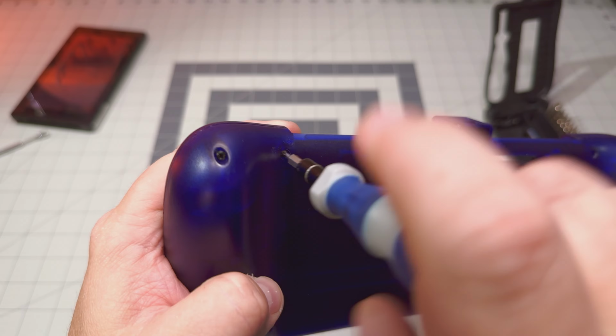Right? Nice and gentle. Don't need to force anything. Make sure that gate is open. Grab that ribbon cable, slide it in there, then just push down on the sides. That's going to lock it in. Again, nice to have tweezers, just push on the edges there, make sure that's nice and locked in. Okay, give it a little tug, make sure it's in.